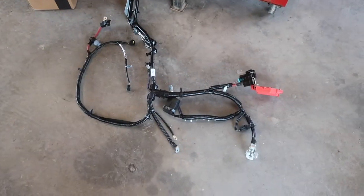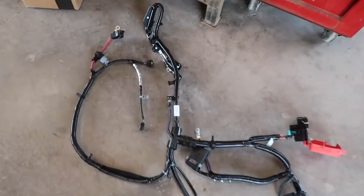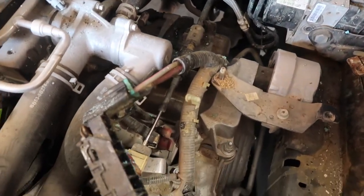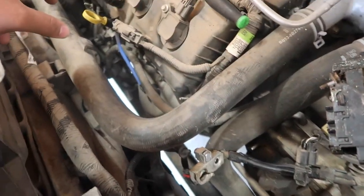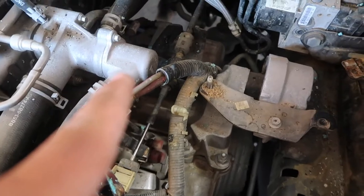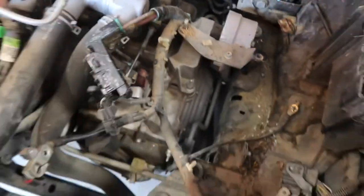This is the battery cable. I didn't think it was going to have that many connections. I took the air box off and I'm going to spray the terminal with brake cleaner, then raise the car up because I have a feeling some of these connections connect to the steering rack. The positive and negative cable are all in one. One side connects to the alternator, then runs to the starter in the middle, and I think the other side goes to the rack. There are also ground points — one there and one down below.